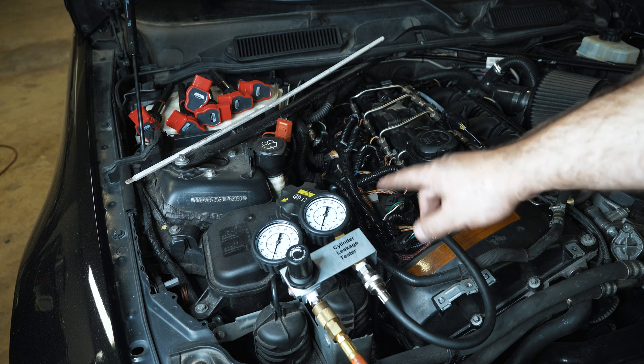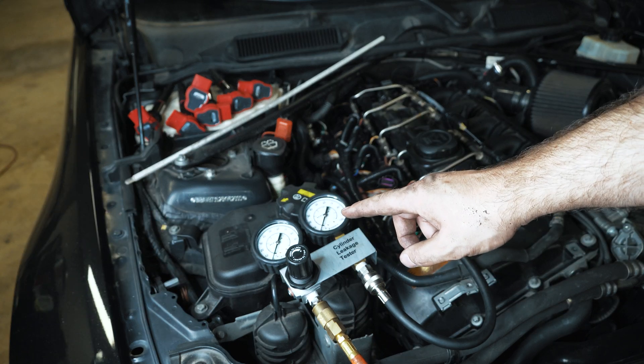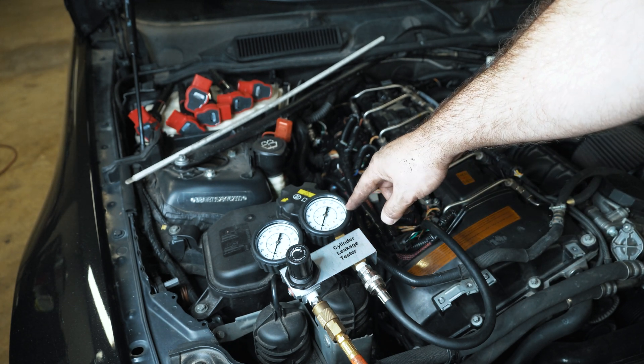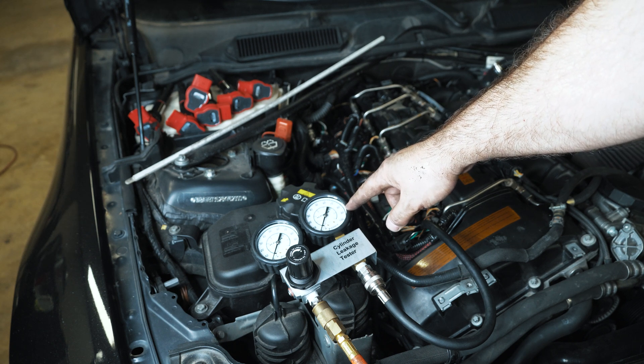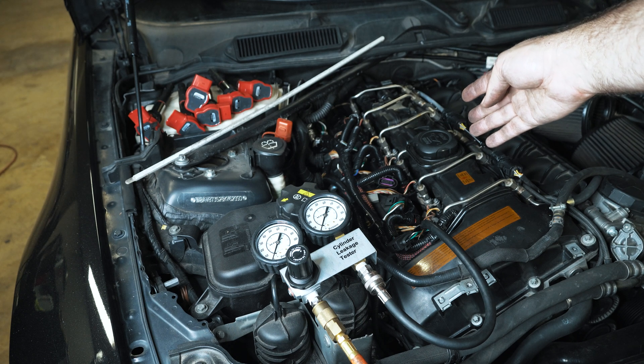Up to 20 percent loss is acceptable, but on a really healthy motor you don't want more than 10 percent loss. So I wouldn't want to go past 90 here to say that this motor is within new spec — but it's literally as if this was just assembled at the factory and just finished breaking in.